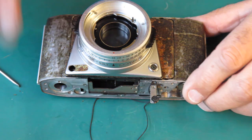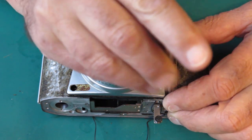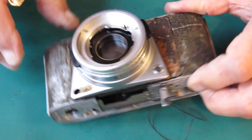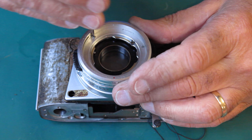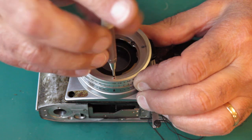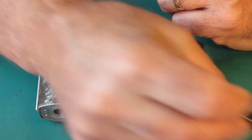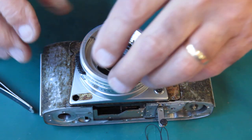I'll put those leatherettes to one side. Now I'll remove the front rings from the shutter. Let's get that in the normal position to remove them and see what position everything is inside there. If somebody's had these rings off and put them back in the wrong place, then the rings would have been misaligned and there would have been no chance that the meter would work correctly, or at all. One of these screw heads is a bit mutilated and I'll deal with that later.